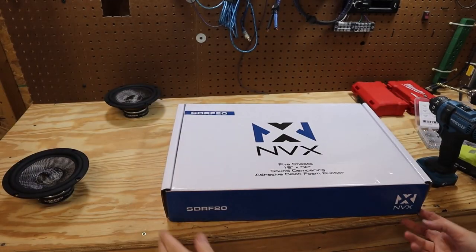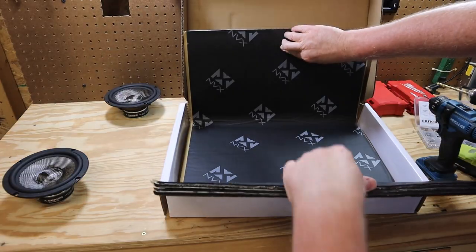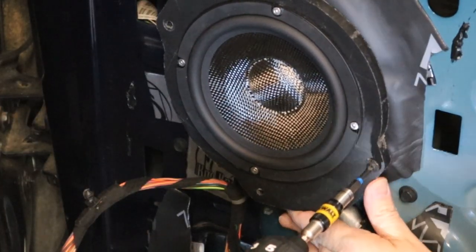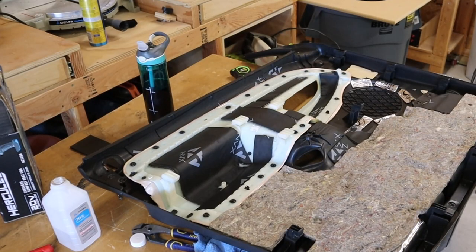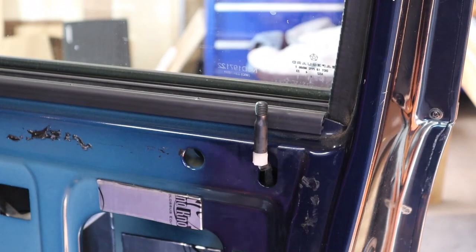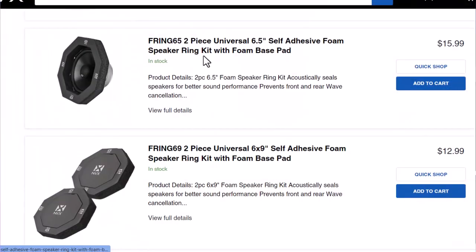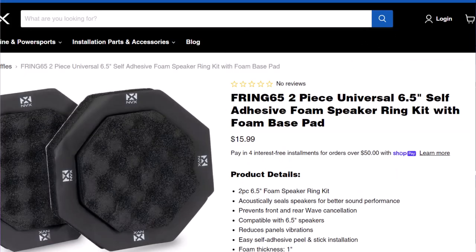While the doors are off it's a good idea to add some extra sound deadening. I bought this from NVX as well — it's a lightweight butyl and foil deadener with an additional layer of foam. That foam is there to keep parts from banging together when they rub up against each other. I'm putting some around the factory speaker opening for additional dampening, and the foam will serve as a gasket between the door and the speaker ring. For the door cards, instead of full coverage my plan is to apply sound deadener to areas where the door card contacts the door and areas with known rattles. The door lock has been my biggest source of rattles so it's getting wrapped in foam tape. NVX has their own version of the fast ring — it comes in two pieces: one goes inside the door to break up standing waves, and the other goes around the outside edge of the speaker to give you a good tight seal and direct sound into the cabin instead of having it bounce around inside the door card.